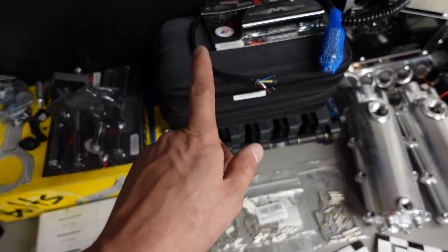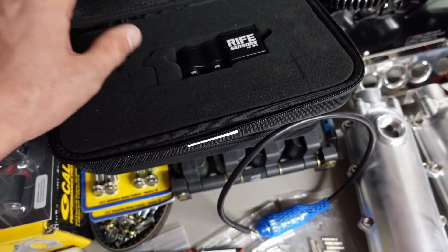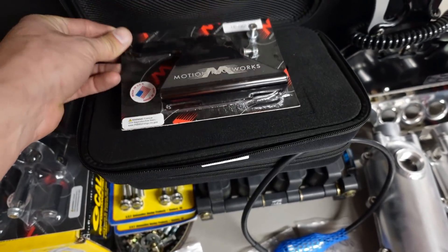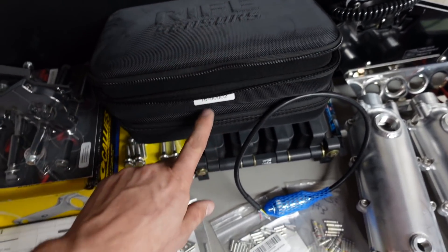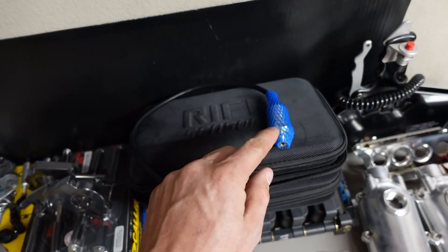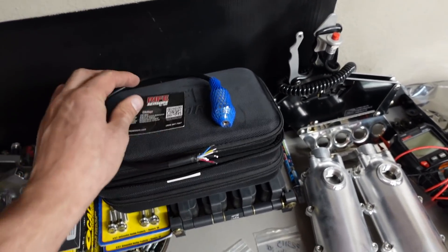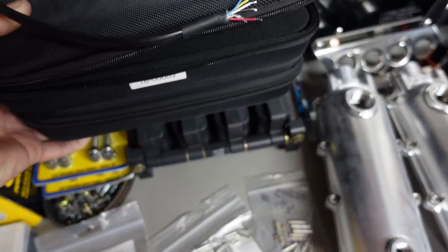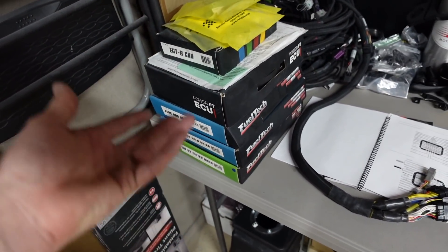The last piece for this car is sensors. There are ride height sensors made by TBM — The Brake Man. There's a transmission one with two pressures on it, and Motion Race Works makes a bracket to put it on the tail shaft of the transmission. There's also a pressure sensor with four different pressures built into one, and a coolant temp and coolant pressure sensor combined into one — so you no longer need two sensors. We'll also be putting FuelTech smart coils on there.